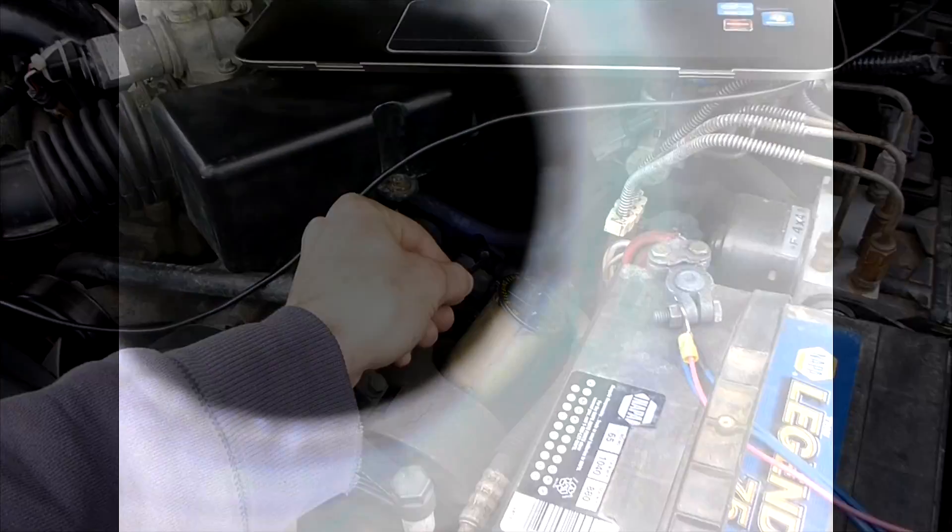So that's cylinders one through three. Let's check out cylinders four through six. Cylinder four — the before and after looks about the same. Actually the carbon buildup on the edge does look a little bit better. Not much, not significant, but there seems to be some cleaning. Let's check out cylinder five. That carbon is still there. Looking at the before and after, if you look at the right of the screen, you can see the after has less carbon — some of that carbon was cleaned up. This is probably the most significant change we've seen so far, but still most of that carbon is left in that cylinder, so it's nothing significant.